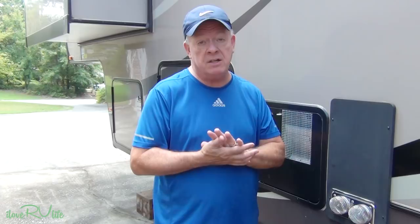This is going to be another yearly maintenance task — very, very important. If you ever go to campgrounds where you're having to use your water storage, you want to make sure you have a sanitized water tank. Joan and I did three months of winter travel this year. We've got a winterized four-season camper with blankets under our tanks to keep them from freezing, and it really works. We had to use our water tank because even with a heated water hose, the water spigot we were connected to would freeze up. So in the evenings when it was much colder, we had to use our onboard water tank for drinking water, water to flush, and maybe a shower the next morning. So it's very important to have that tank sanitized each year.